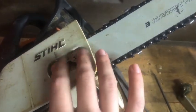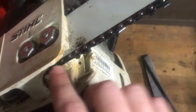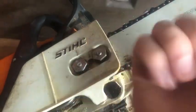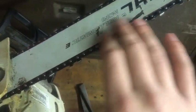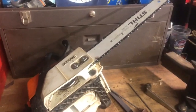It's very important that both nuts have the same amount of tension. The new chain happened to be tight enough that the tension looked just fine, so I went ahead and cranked the nuts down — keeping them even. You don't have to go crazy on them, just snug them up and make sure they're tight. If the chain gets loose later, back the nuts off about two turns each, make the bar just loose enough to adjust the tensioner screw, tighten the chain, then tighten the nuts back. The small saw is ready to go.